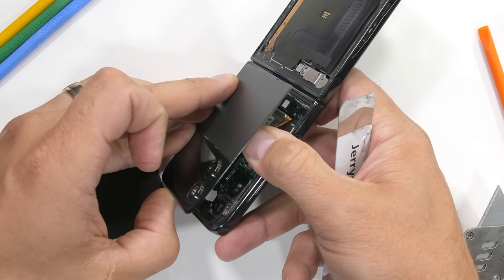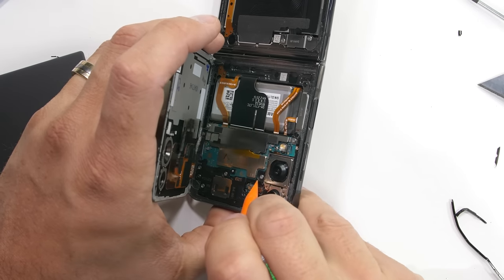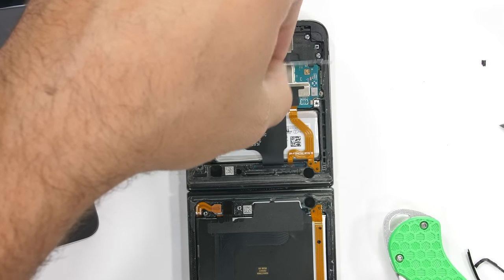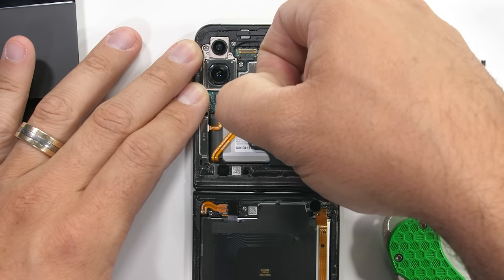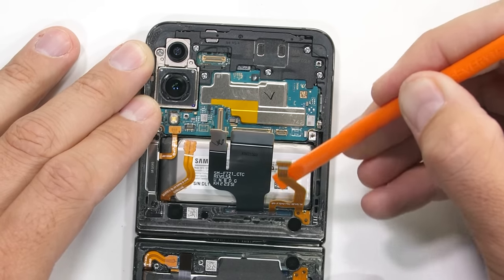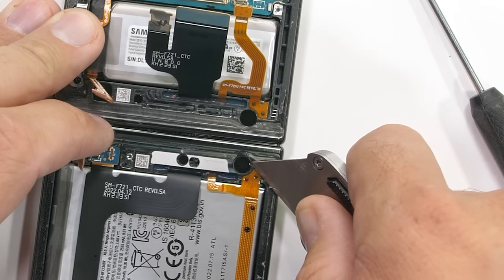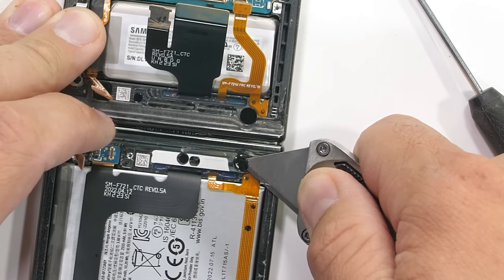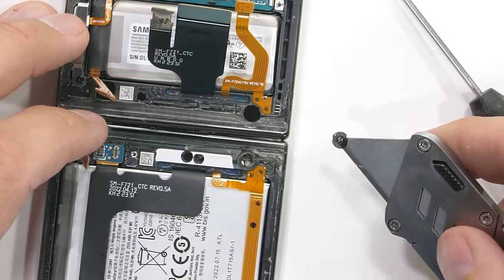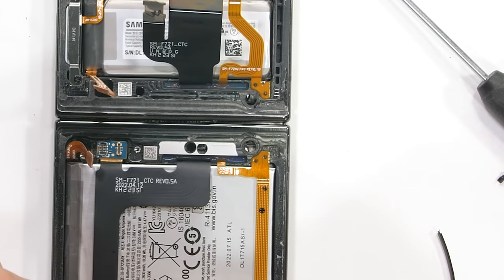I'm also avoiding putting any stress on the ribbon cables as it's lifted off, and the screen ribbon can be detached just like a little Lego. With the internals now exposed, we can remove four silver screws and two metal brackets, which gives us access to the battery plugs for the top battery as well as the bottom battery, along with the 15-watt wireless charger that's also capable of reverse wireless charging at 4.5 watts. If we mosey on over to the center hinge, I do see two circular stickers on either half that when removed allow us to peer into its depths, though I'm not quite sure why these stickers exist — they wouldn't help much with waterproofing, so let me know in the comments.